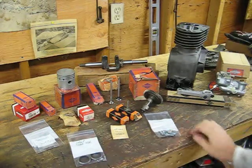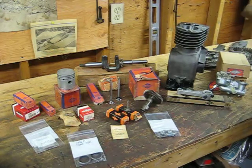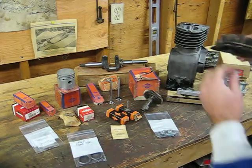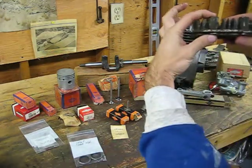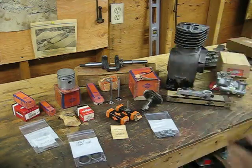I've got a lot of other seals and a screw kit. I did get an NOS head — it's right here — but it's not going to work. It's the correct part number, it's just not going to work. The reason why is because the bolt stands are real shallow on the NOS head. I need the thicker one in order to carry the weight and securely mount the gas tank to it.